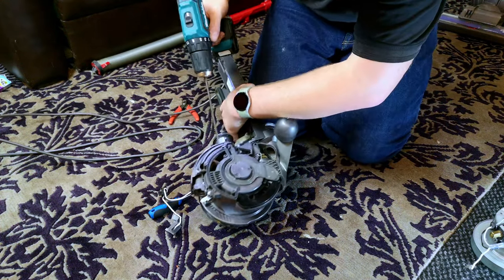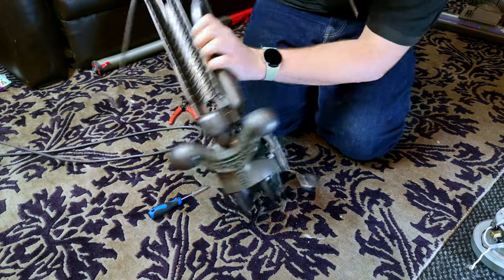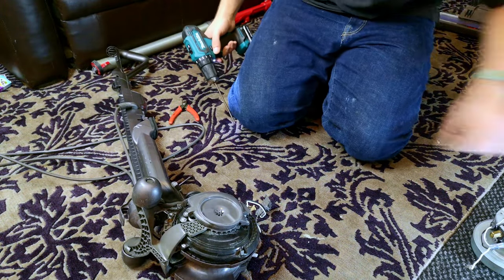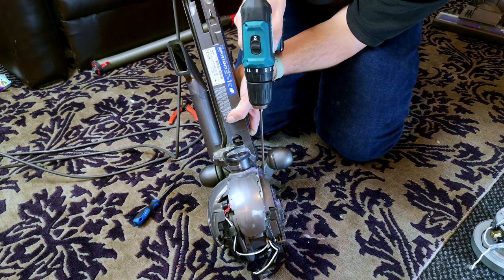Then under your back hose - that's disgusting, yeah, that's where that came from. We'll have to sort that out later when it all goes back together. Because now we can jostle off the entire yoke assembly. Peel your wires gingerly back so the loom comes out. Isn't that disgusting, whatever it is. This is our brush roll loom - we can push the rubber foam seal through here carefully and remove it. We can't go much further yet until we remove the suction ducts.